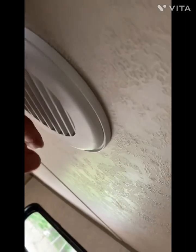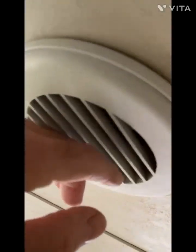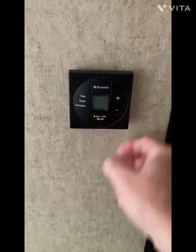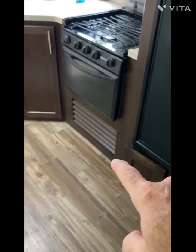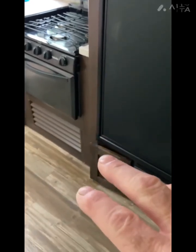And up top here, the heat pump just blows a little bit of warm air. It's very hard to tell that it's any warmer than the ambient air. But that's the heater. Switch it to off. And the way the gas furnace works is it continues to cycle a blower on it, just to make it cool down for about a minute or two. I don't know if you can hear it, but see, that propane furnace is still circulating air and cooling down the propane furnace part. And it'll do that for about a minute.